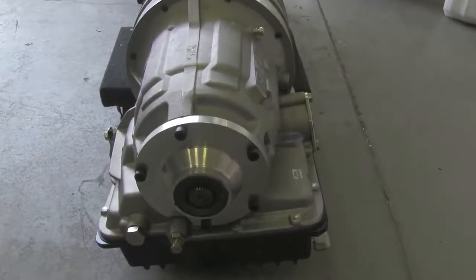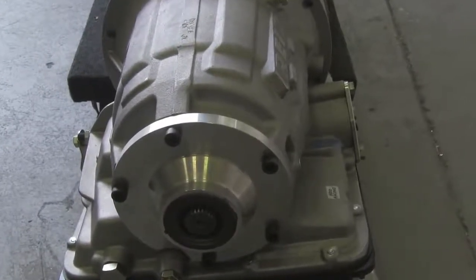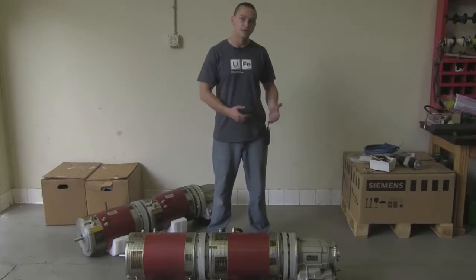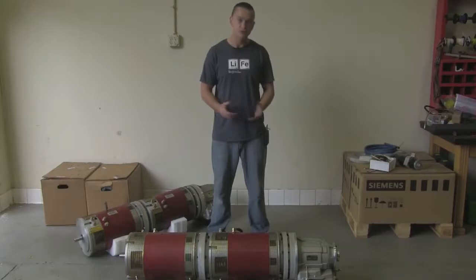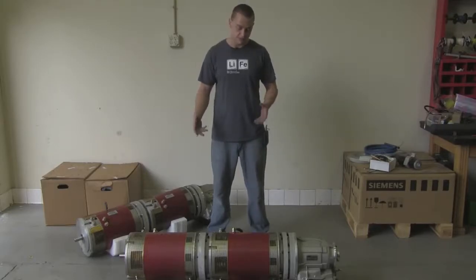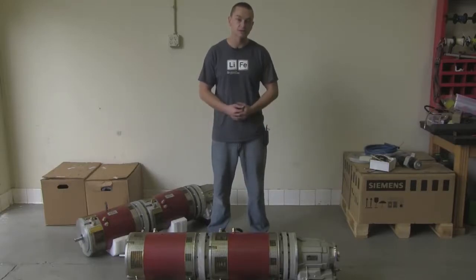Some great features: it is more than capable of handling any torque these two motors can put out, but it also has park — which is really important with electric cars. These motors freewheel, and if you just rely on engine holdback like you would on a gas engine, it will just roll down the hill. You can use your e-brake as a backup too. It does have reverse, which is another big deal with DC motors. There's a lot entailed in reversing contactors to get motors to spin in reverse, so having a transmission with reverse drastically simplifies the conversion.